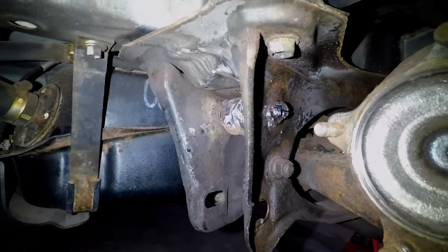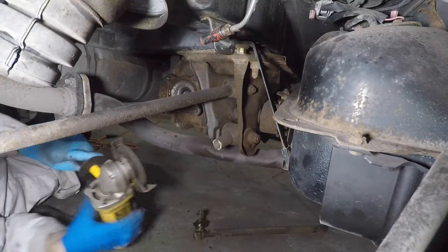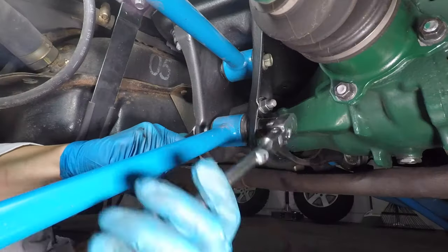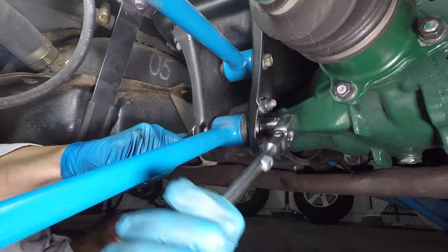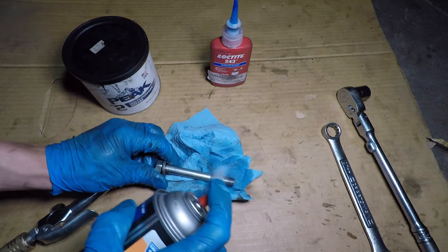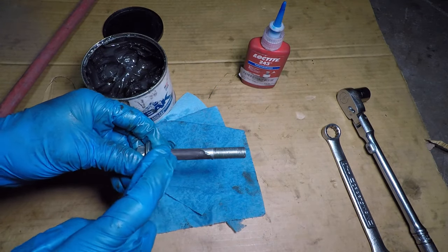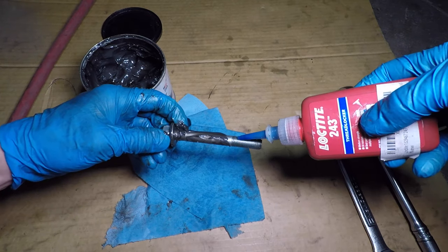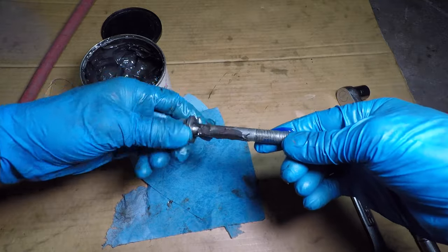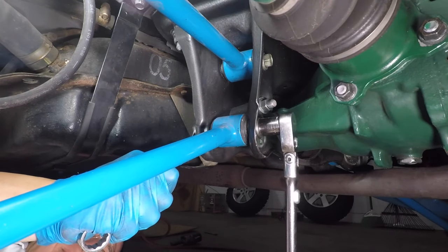This is video from my lift kit installation earlier this year. The rear camber adjusters were extremely rusty. I couldn't unscrew them and ended up cutting off the tie rods and replacing the differential crossmember. These little bastards were the beginning of all my problems. Let's take these bolts out and get all that grease off the threads. Here I have a little dilemma: do I leave the bolt clean and have it rust solid later, or do I grease it and die the next time I drive my car at 80 miles an hour? I'll grease the shaft and Loctite the threads. I'll torque that to super tight and hope my car stays in one piece this time.